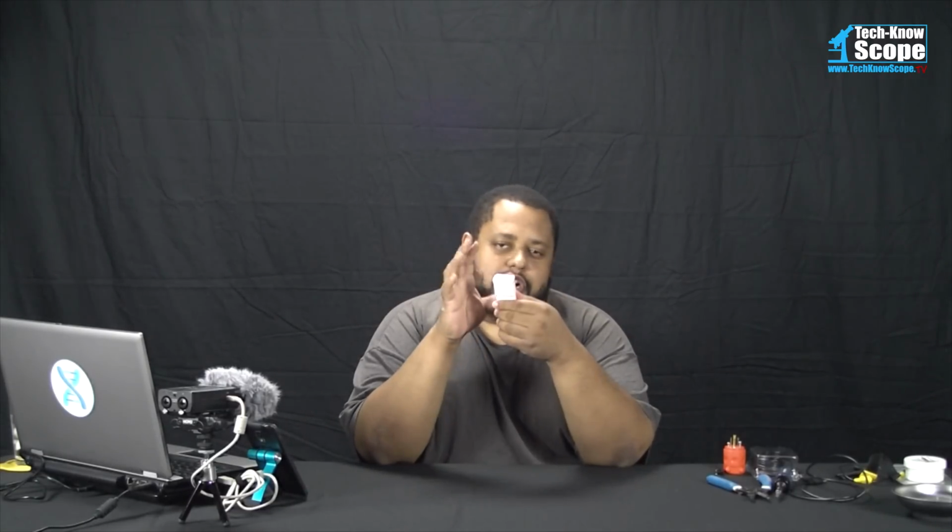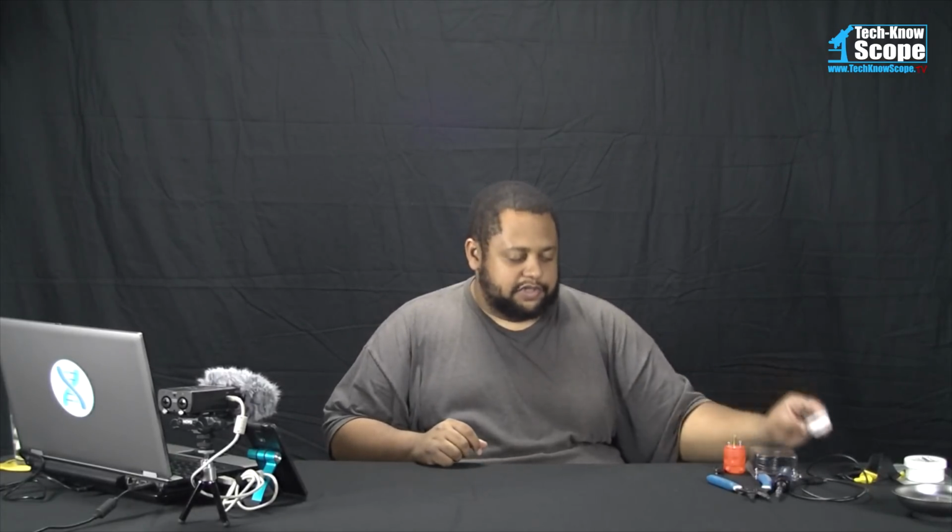But if you don't want to go this route, if you don't have one of these, do not go buy one of these to do this. This is affordable because I already had one. If you had to go buy this little guy, this thing would cost you about $30 from Samsung. Now there are cheaper 2.0 power supplies out there, but even all the same, I wouldn't go buy one for this. Instead of doing that, I would use a 5 volt dedicated power supply, and I'll link to one of those down in the description below as well.